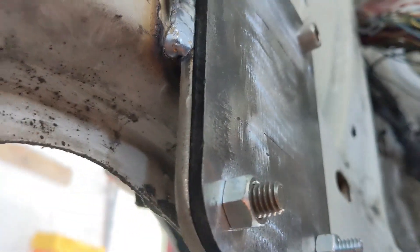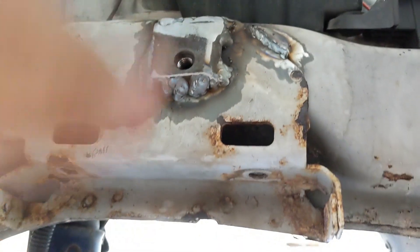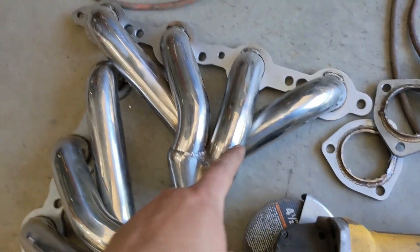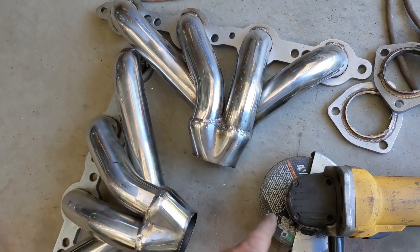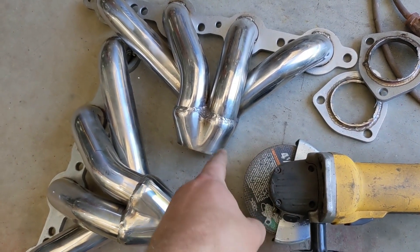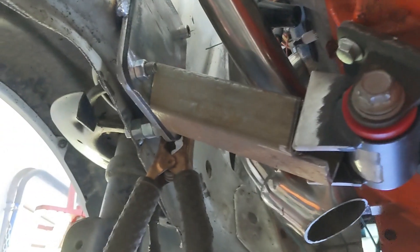Okay, plate is all buzzed in, the secondary plate is bolted to it — that's what the engine mount is going to hook to. And over here we've got our upper mount which is going to keep this one from rocking. Sorry Mr. Chinaman, I just cut off your welds here. This one was going to be in the way of the steering rack, plus it's going to be better to have this 90-degree piece come down for the car all in one piece and have the flange here. I've got to have a disconnect here anyway — I don't want two flanges, just more places to leak. I'd rather just have the one here. Okay, I got this side ready to tack in.